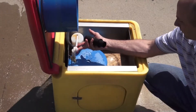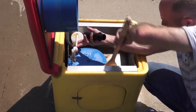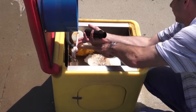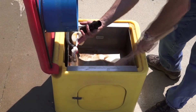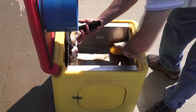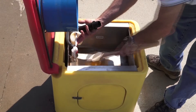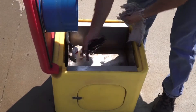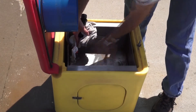I'm going to let all that water drain out. Now I've got a lot of debris and dirt in here. I'll go ahead and pull that disc out. I'm just going to use a brush to get as much of that loose as I can. Anything I can't reach with the brush, I can use a rag. I'll go ahead and rinse that a little, let all that dirt get out of there.